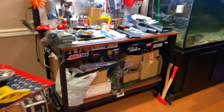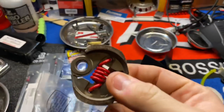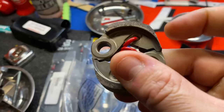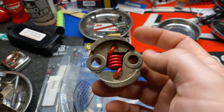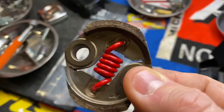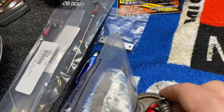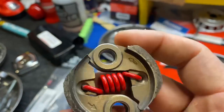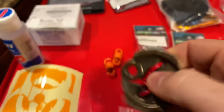The only thing I forgot was an FS clutch but I'm not going to use it because I got a drag-modified clutch — a Bartolone clutch. This is an 8000 spring, see? There's the modified one — lightweight. From the modification Bartolone did, it'll actually feel more like 9000 or 8500 RPMs. I'm gonna see how that one works. These custom springs are a little more consistent. The stock stiff ones are ridiculous — even just mounting them and squeezing them on is crazy.